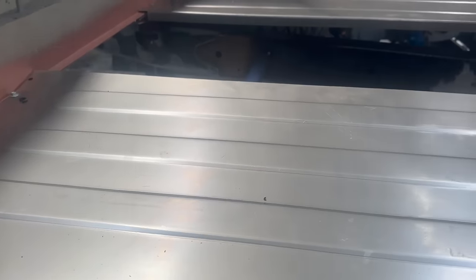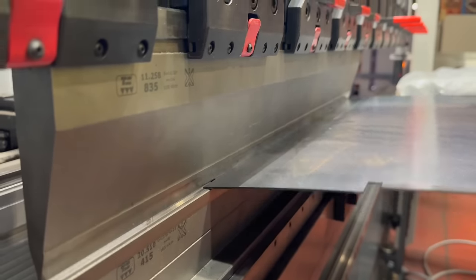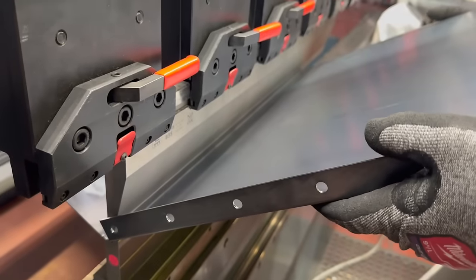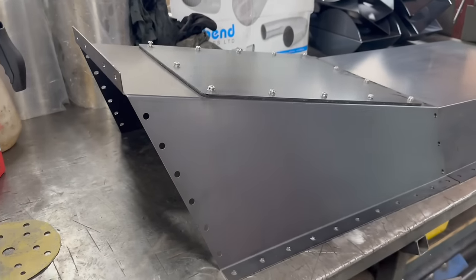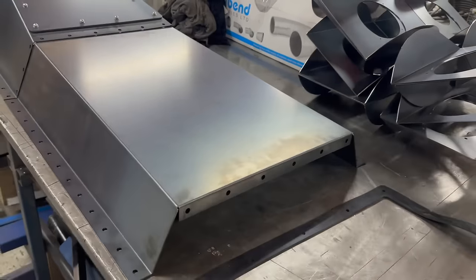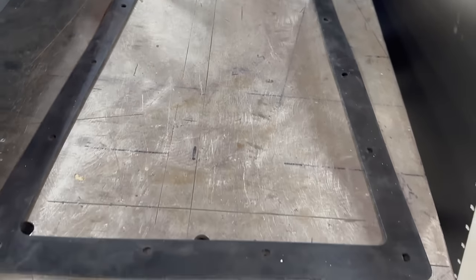The new floors look good. It's worth noting this is a custom set to account for the extra cab length. Time to fold up the transmission tunnel now and we're at the local laser cutters to utilize their CNC press brake. This is the completed transmission tunnel. The new design gives plenty of rearward clearance to any powertrain combo and makes jobs like gearbox and transfer case removal very easy. It's made from 1.2mm steel and features a removable lid with a 3mm rubber gasket which was water jet cut to keep the cab nice and dry.